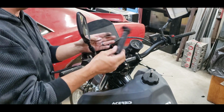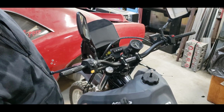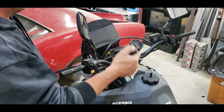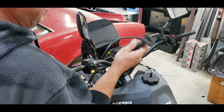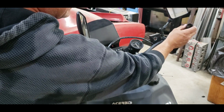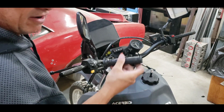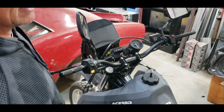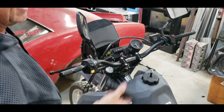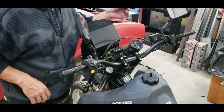I think a lot of people could save yourself the $15 and clean it. It's pretty easy. Then you've got a factory tube. It's not metal. It's not going to gall against the aluminum. Plastic, in my opinion, is a better mate with an anodized or powder coated piece of aluminum. It's just going to last longer and not gall up and get tight on you. And if it gets dirt in there, it's going to have less tendency to grit and to seize up on you. So that's just my 2 cents on that deal.